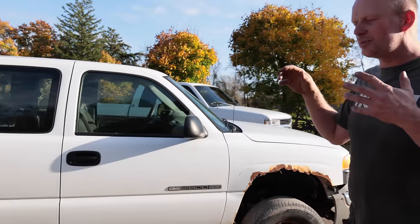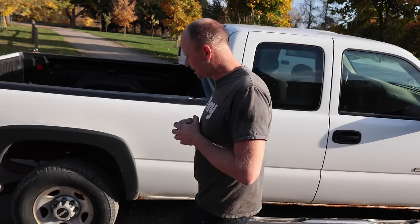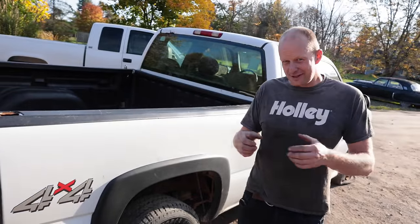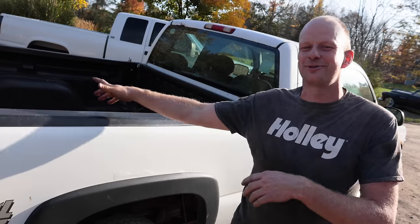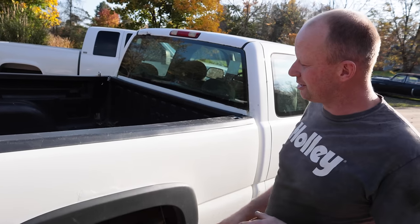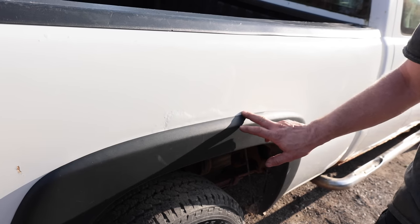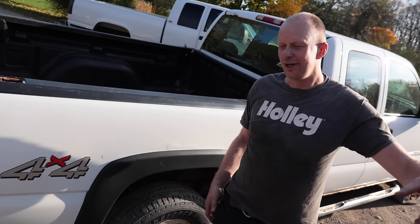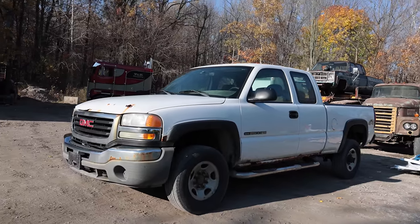This is an '06, this video was filmed in 2023, so it's about 15-16 years old. Even though the doors aren't bad, the rockers are completely gone. This was an old farm truck — it did pull a camper. It's the heavy-duty version which I think has the 4.11 rear end. The rear end has a leak and it actually has a wheel seal leaking on the inside. What happened when all the oil leaked out of the diff is that the diff actually exploded. The story was that he was driving along and a chunk from the diff and the driveshaft flew into a field and actually lit the field on fire.